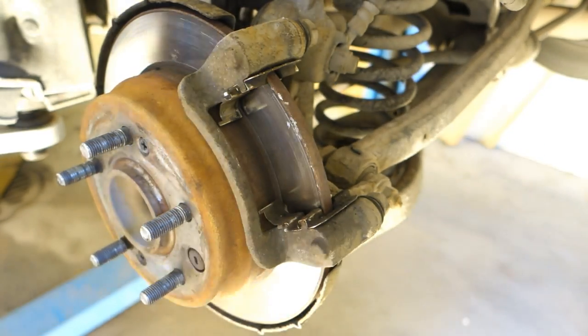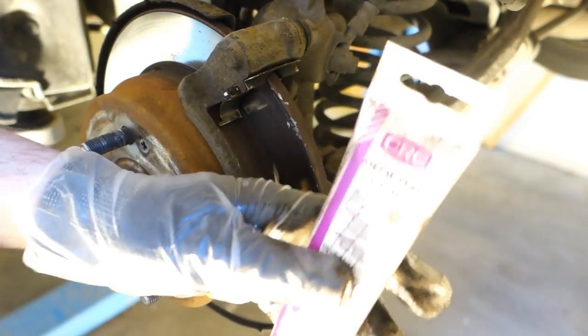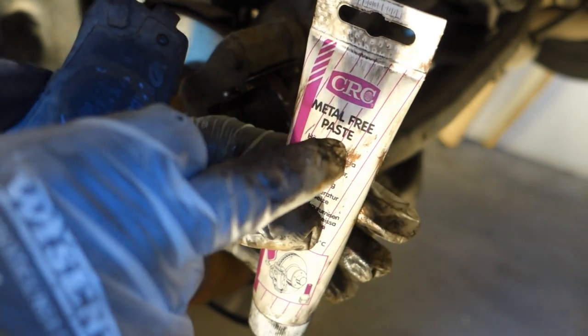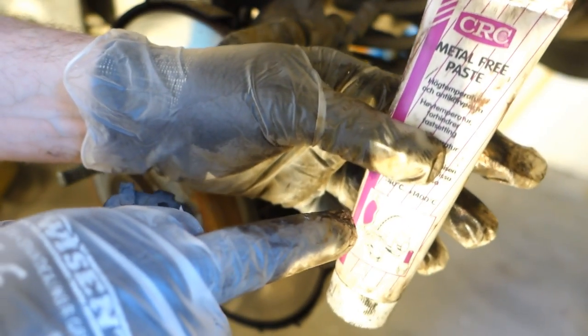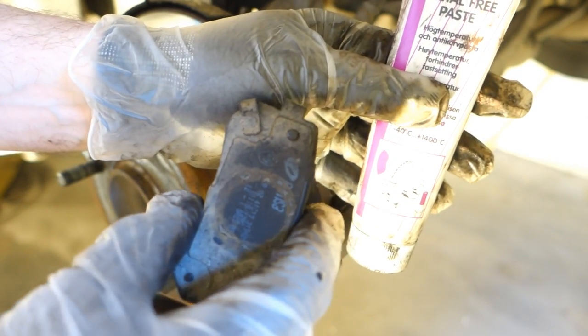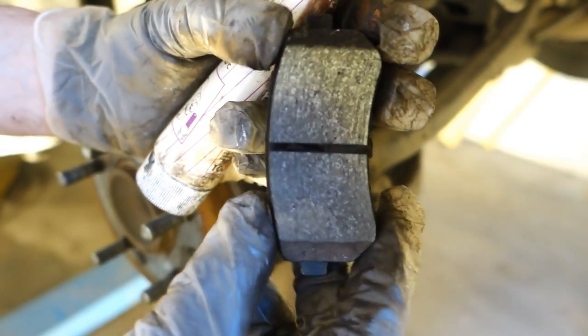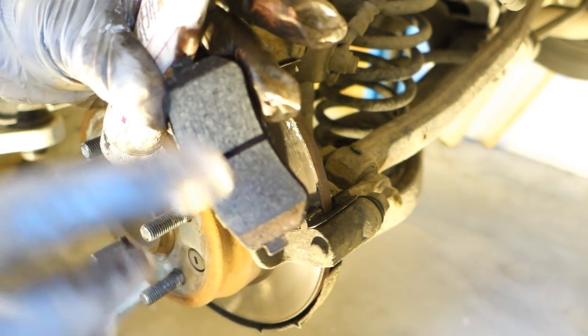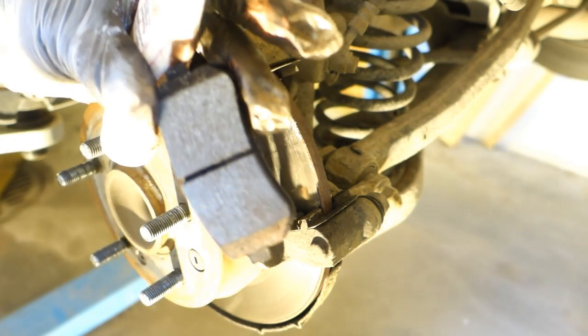And then when I install these new brake pads back, I first need this special grease and lubricant, and its name is metal free paste. And this paste is suitable for, there is a picture in that area, these areas for brake pads, remember, not in that area. In that area in here, it looks like this metallic surface that goes against this brake disc. This is always clean. No oils or paints in that area. All materials are forbidden. No paste or lubricant in here.